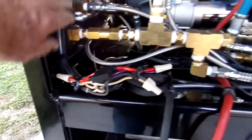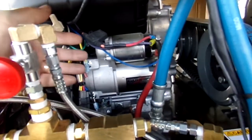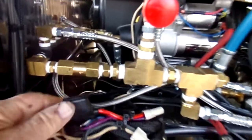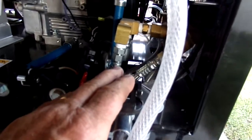It's just one single feed. You've got a fuse here, and a 30-amp fuse as well. That controls the juice going to your solenoid or your solenoid starter, and this controls the voltages going to your panel and via over here to your accessory. We have a separate fuse that separates these two electrical systems, so that if this fails on one end, it's not going to blow the main — it'll just blow this one out and not affect all the other previous circuit.